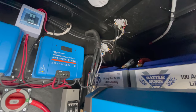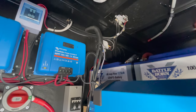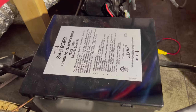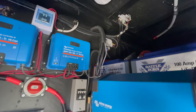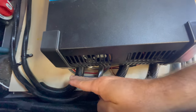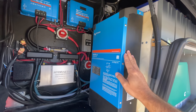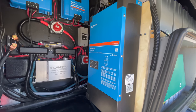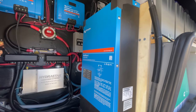Now the AC side — the alternating current 120-volt side — is super simple. We've got a 6-3 Romex, which is six-gauge with hot one, hot two, neutral, and ground. That comes through straight from the ATS, the automatic transfer switch, which will have power either from shore power or from the generator. That comes straight into the inverter, and then coming out of the inverter goes straight up to the distribution panel. So everything AC-powered goes through here, just like with the GoPower — it can supply power in PowerShare mode or inverter mode and power the entire RV.